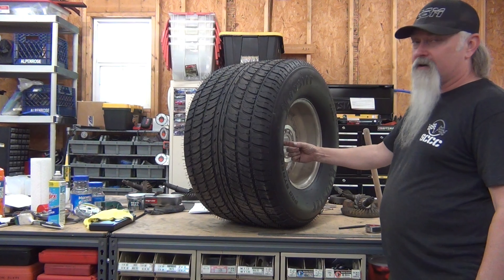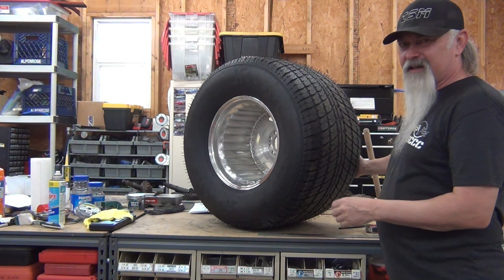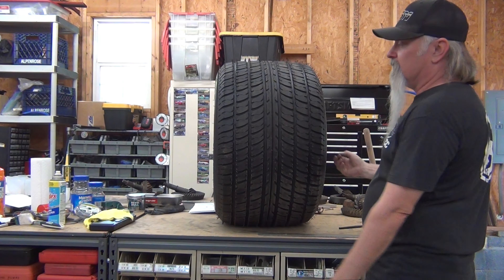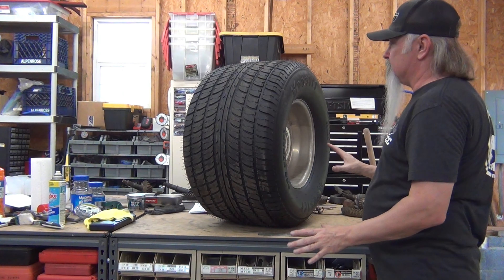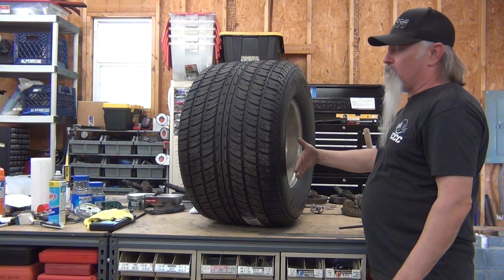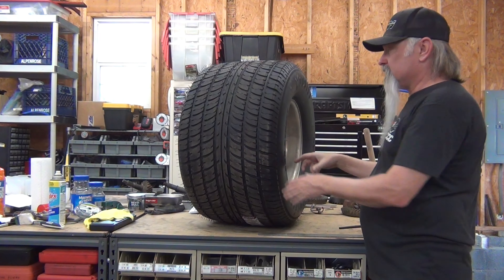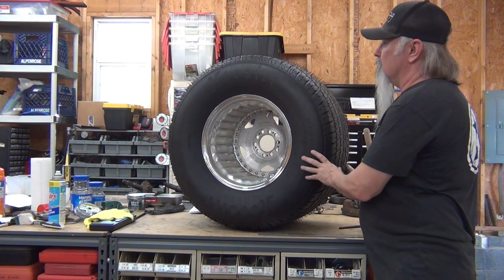But because this is offset and an inch and a quarter is coming to this side and only a quarter inch to the front, what's going to happen is this tire tread is going to shift this way a little bit to compensate for the big change on this side and the tiny change on the other side. The extra inch and a quarter back here is going to shift this whole tread over and push this out probably about five eighths to three quarters of an inch inside. So all I have to do to be able to update to 15 inch wheels later is leave that extra space between my frame rail and the sidewall. This front area is going to stay in basically the same spot or even pull in a little bit and give me more clearance to the outside. So that works perfect.